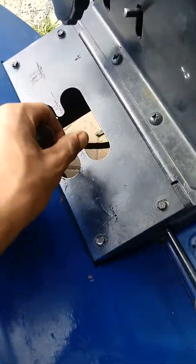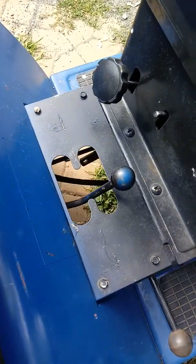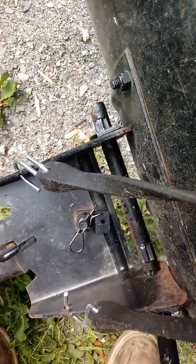There's one, two, reverse, and three. But I don't have the clutch in so it won't go. Park and brake is that little knob right here. The plow is pretty jiffy-dicked on — the original holes didn't really match up to anything, so I just drilled four holes and put some bolts in. One fell out. I made my own pin because it was missing a lot. This used to have a little lever with a spring that came somewhere, and that didn't come with it so I just made my own. I grabbed a rubber bungee cord and wrapped that around — that works pretty good on light stuff.